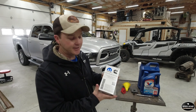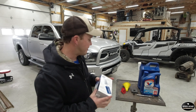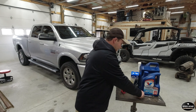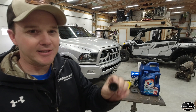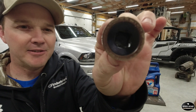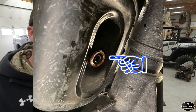I'm going to be using a Mopar filter — I like to stay with manufacturer-grade filters, also just to satisfy the warranty. You'll need a clean funnel and a 3/8-drive ratchet; that's all you need to service your Cummins. All you need to pull the drain plug on this is just this 3/8 head — I've already pulled it out, no socket needed, just a 3/8 drive. I'll show you a quick picture of what the bottom of the oil pan looks like.